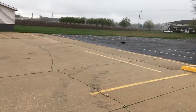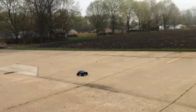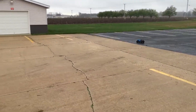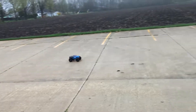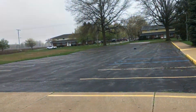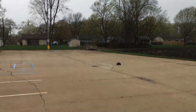A lot faster than stock out of the box with the little 550 brush motor. That 550 brush motor wasn't bad, but it just wasn't enough speed for me. It would be enough speed for a beginner, but as I've been progressing I've been wanting a little more speed to tinker with. I just felt I wanted to upgrade to brushless. This is a cheap little brushless motor I put in — nothing too crazy expensive. Steering's off a little bit — I'm gonna fix that just a little bit. She's cooking pretty good on 2S with just a little 2200 milliamp-hour LiPo.